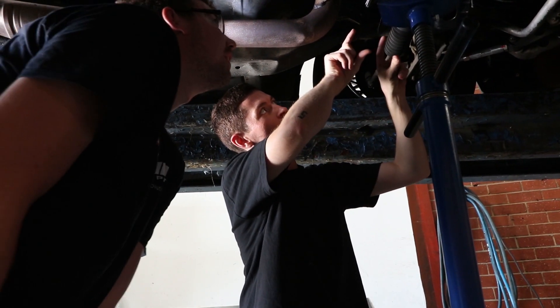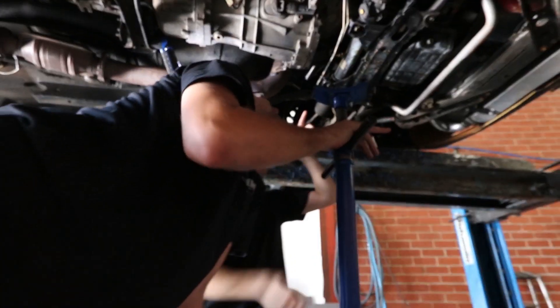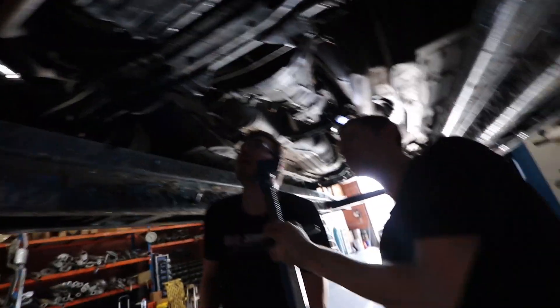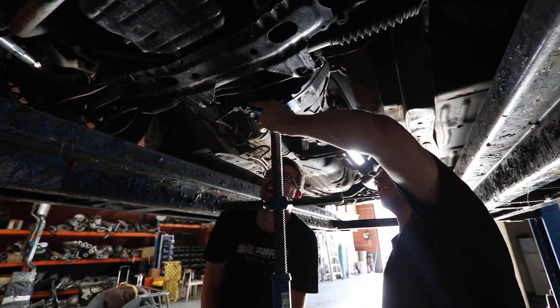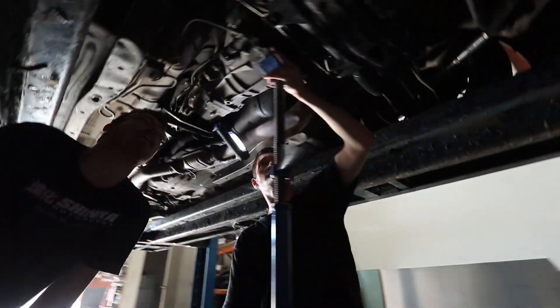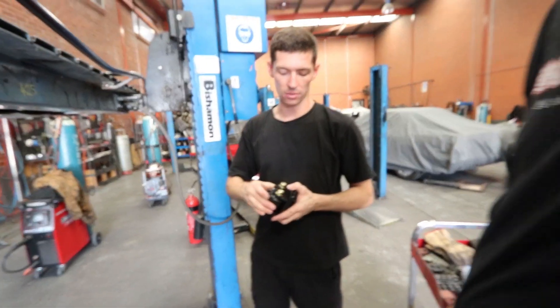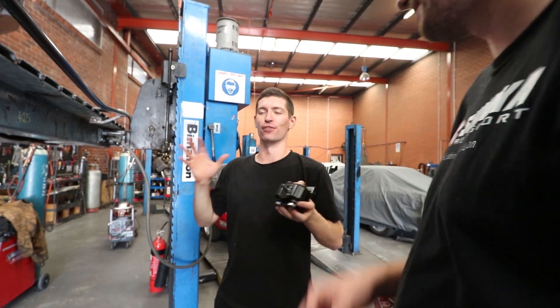You need to get those four bolts out of the block. You need to pull that out and it's a pain in the arms. The top two bolts are right behind the turbo and you can't even see that one. It actually refused to fit anything except Cusco's. I just recommend them to any mates, they're really good. They're probably urethane still — well, it's just hard rubber. As soon as we get them in there and you take it for a drive you'll notice the vibrations because they're a lot stiffer. Just at idle everything shakes.